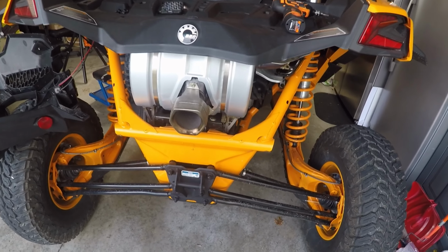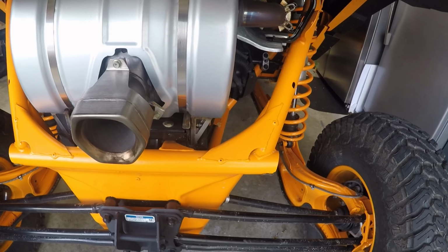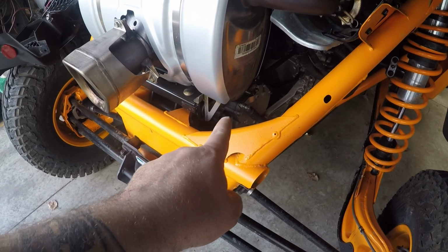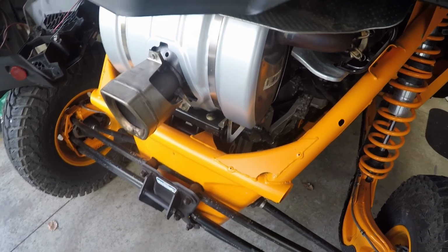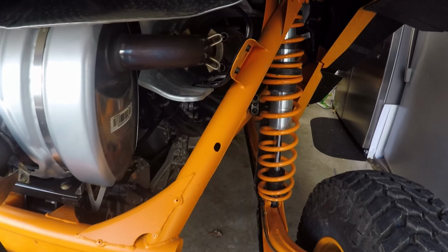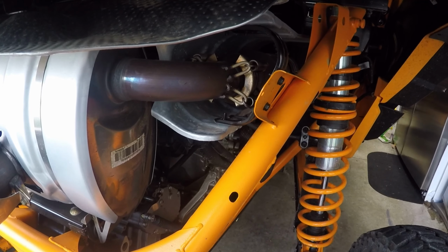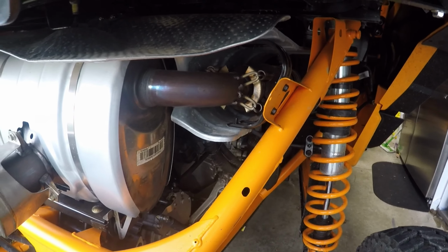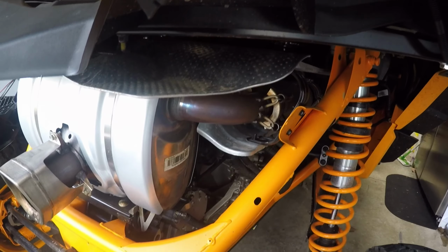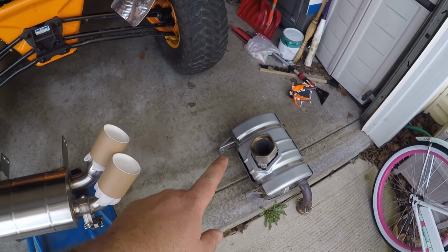Now I'm not gonna go into too much depth here on exactly removing the muffler because I went over that in my last video, where you're gonna pull out two of the 13s with bolts and nuts there, and there on the bottom part of the bracket. Then we've got our 4 factory springs right there to pull back off and remove from the exhaust. At that point, you also want to take this heat shield loose, and then this rear muffler will pull right on out.